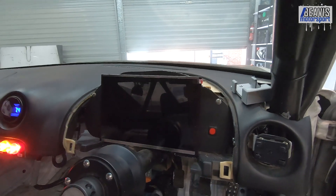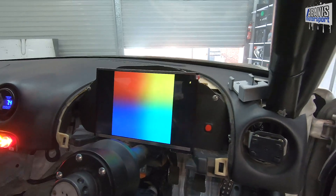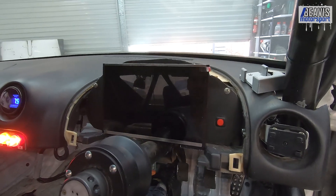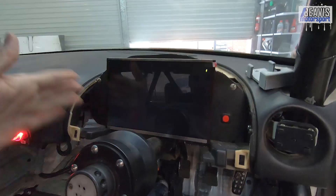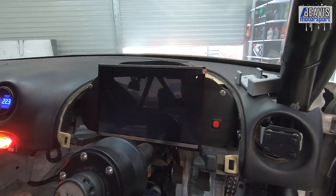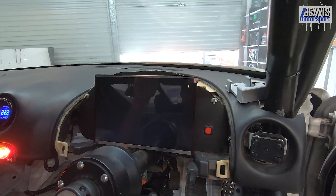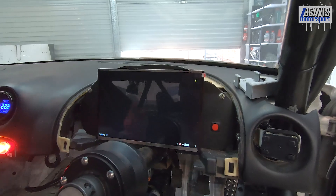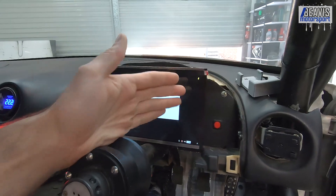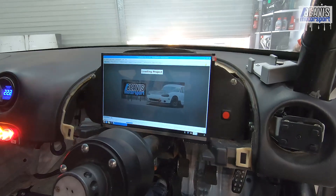So, if I power on the car and flick on the power for the Pi, it takes around about a minute to go from dead to showing the actual dashboard. Raspberry Pi runs on a Linux-based OS, so we see all the typical Linux-y words come up. Ignore the lightning bolt up here — I know it means something to do with low voltage, but I'm running a high amperage full 5V DC converter and it still shows up. I've got separate power sources for the Pi and the screen, and even plugging it into a wall with a 3-amp Samsung high output charger it still comes up. But it seems to not impact the operation of the screen or the Pi, so I'm not too worried about that.